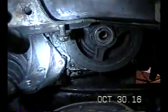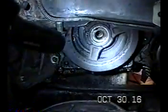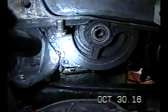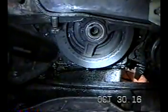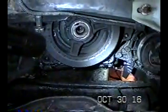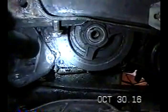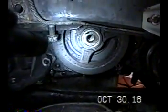It's a 10 millimeter bolt around the engine cover that's very difficult to get off unless you move this brace around. So you've got to do that. I did take all the 10 millimeter timing chain cover bolts off, and that's not any fun. You can do it, but it takes time. You might spend 20 minutes working on just one bolt, but anyway, I did that because I needed to buy some time because I need to go up to the auto parts store to get the harmonic balancer puller.